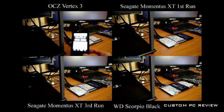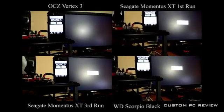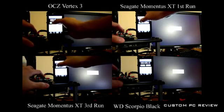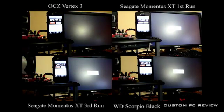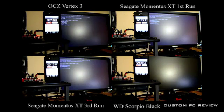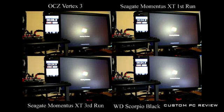Okay guys, so thanks for sticking around. For the purposes of this test, what I done was cloned the test bench drive — the Patriot Pyro SE 120-gigabyte — onto each of these drives. This way I can ensure that each drive will have an equal amount of data, and more importantly, the same data. I did my best to push the timer and the system power button at the same time. For the SSD and the traditional hard drive, I put the video of the third boot in, and for the hybrid hard drive, I put the video of the first and third boot in there, so you can see them clearly labeled.